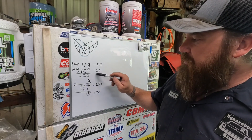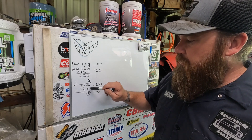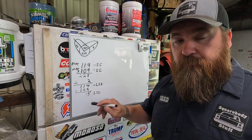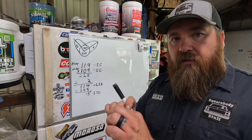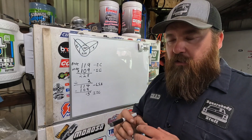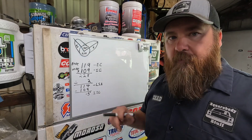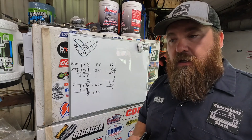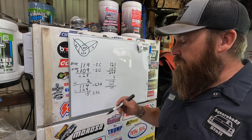Now, this 109 is our intake center where it's installed at. You take that away from your LSA and that's how many degrees advanced the cam is installed. That still means if you just line up dot to dot on the timing set, you're not straight up — you're plus 5 degrees because that is actually ground into the pattern of the camshaft. The only way you can change that is by moving your sprockets. If you remember earlier, I said I've got the crankshaft gear installed for plus 2 degrees. So that doesn't mean it's just 2 degrees advanced — it's actually 2 degrees advanced from where it was ground, which is 5 degrees, so we're at 7.